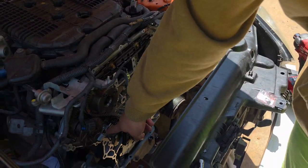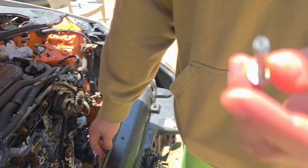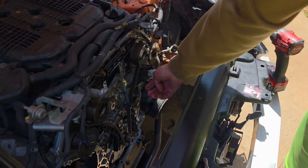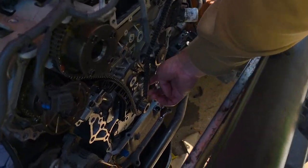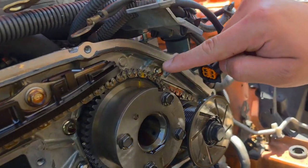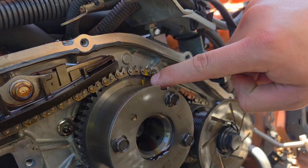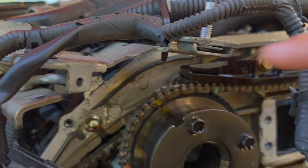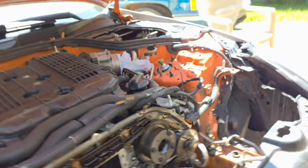We got some 10mm bolts that were exactly the same from the local hardware store that they hooked me up with. And now it's all in tension. Check your points. As we marked, you can see the dot mark on the chain. Dot mark up there. And then now you want me to show them the bottom?